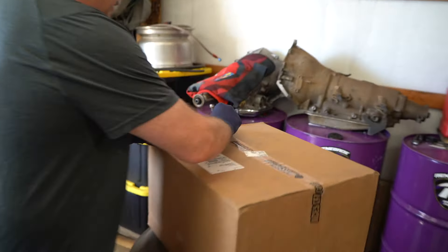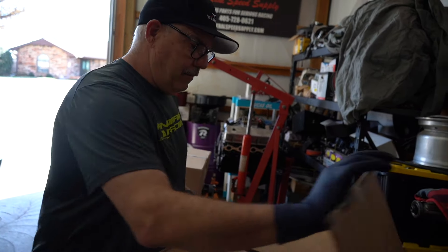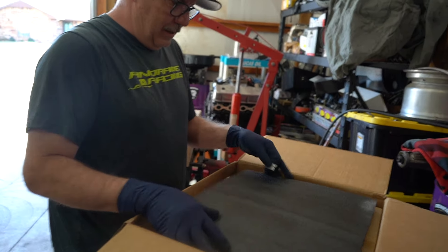We partnered with them and we got two boxes right here. I haven't looked at them yet — ain't even opened them yet. But they're going to be what's running this car. It's a Jackpot top-end kit — a mid-rise intake with a throttle body, 65 pound-an-hour fuel injectors, 7-inch screen, engine control management, and transmission control. We're about to open all this and see what it looks like — you're going to be seeing it for the first time with us because they still got their tape and we haven't even cut it yet.